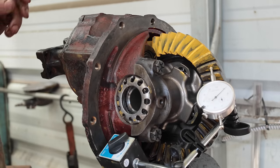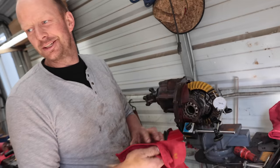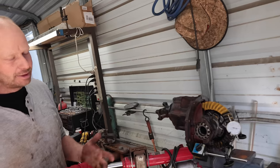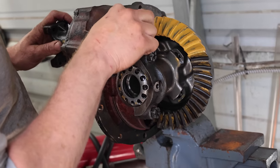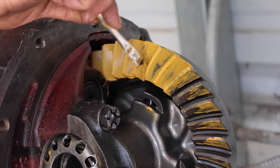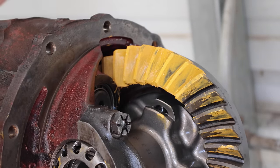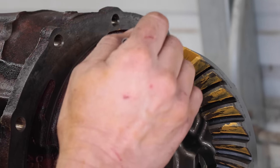Crazy thing is, this hasn't changed from the first horseless buggy till now. Same teeth, same principle, spider gears in the middle. This technology hasn't changed in 150 years, except for like limited slip or something like that. Yeah. Angle it so that it's quiet, so that as you're finishing touching one gear tooth, it already starts touching the next gear tooth. So it's not really ending a process, it's always in the process of the next one.